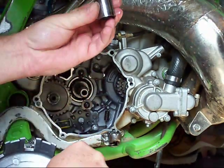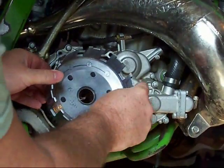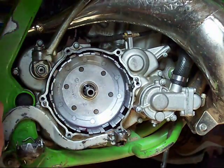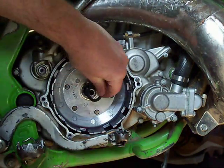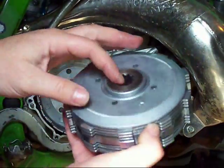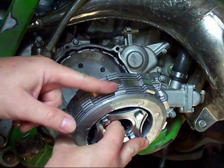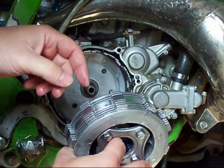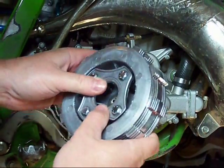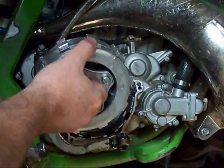So we got the washer, and the bushing, and the basket, like so. Washer, and here we got the pressure plate, friction plates, steel plates, dyna ring in the middle, screws facing out, a slick side of each metal plate against the dyna ring — all that's good. Got the springs and all that installed. I just found it easier to get the thing in and out this way.